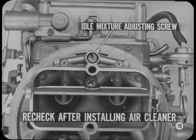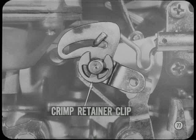Care to add anything, Don? One thing, Tech. If you remove the choke control lever or the accelerator pump lever, be sure to crimp the spring retainer clip when you put it back on. If it spreads, it can fall off. That about wraps it up, Tech.